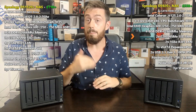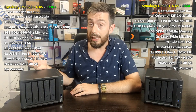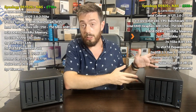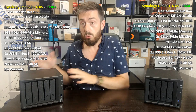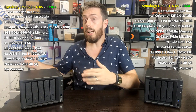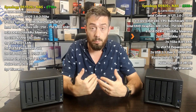The DS1520 Plus comes with 8GB of memory — already twice that of the 920 Plus and the maximum available in DDR4 between these two. On top of that, you get four LAN ports on the rear, giving you potential for one to four gigabit ethernet with link aggregation, versus only two on the 920. The 1520 can also be expanded by two expansion units, adding 10 more drives to the five default bays, versus the 920's maximum of nine total drives. You are genuinely getting more hardware for your money on the 1520, and how you use that hardware later speaks further to its value.